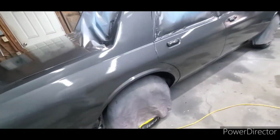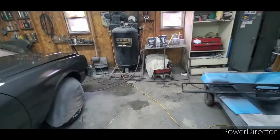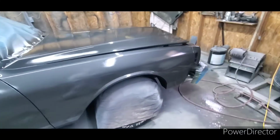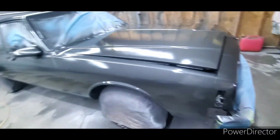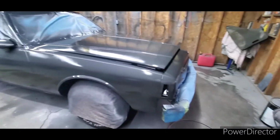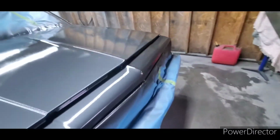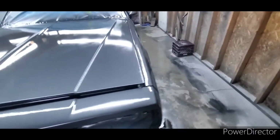But amazingly, here in the 40s, we got 48 degree air coming across this car. And I'm going to touch this in an inconspicuous area, but it's tacked up, and I think it's ready for another coat already. I did not put any polar accelerator in it. So as the fumes are evacuated, just to be on the safe side, I'm going to fire the heater up again and let it warm up on this clear in between coats.